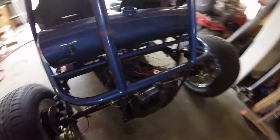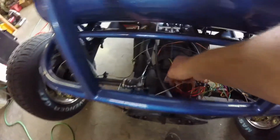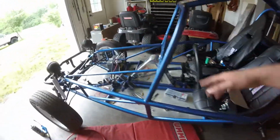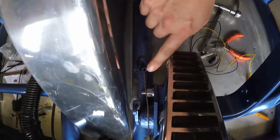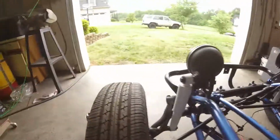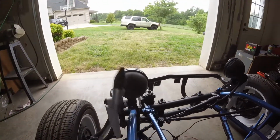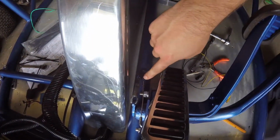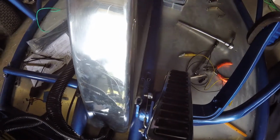I went ahead and put the throttle cable in. It just runs through this hose that comes out of that copper tubing that runs all the way back to the rail there. I just went and put it in there before I forgot. I saw it laying there in a bag. I always make it a point to clean out the little tubing that it goes through with some brake cleaner. I shot brake cleaner through it and took some compressed air with my little rubber nipple thing on there and blew it out. I also always make it a point to spray penetrating oil in both these holes. I've always done that.